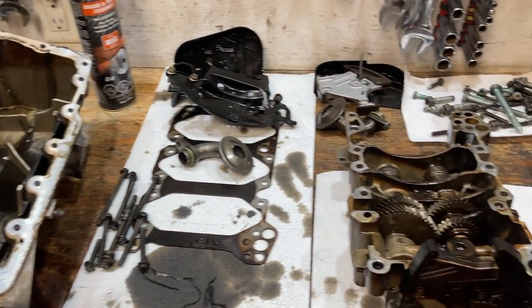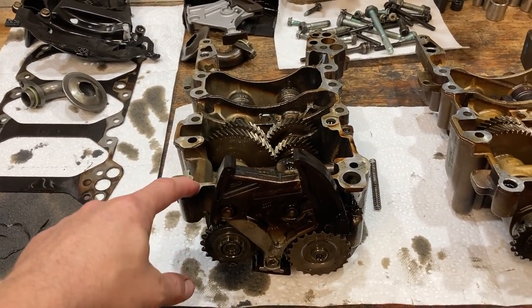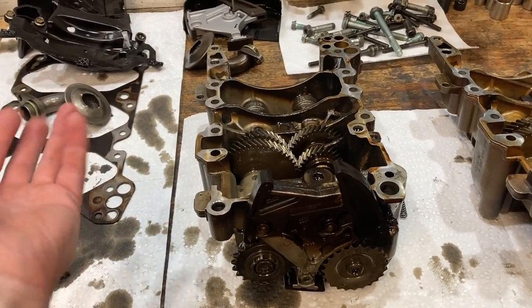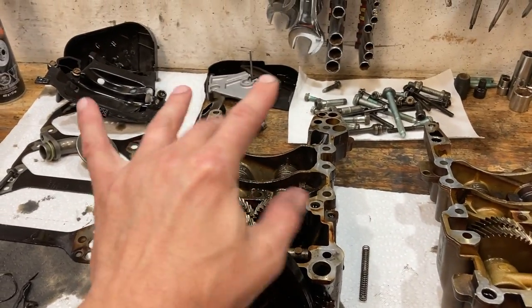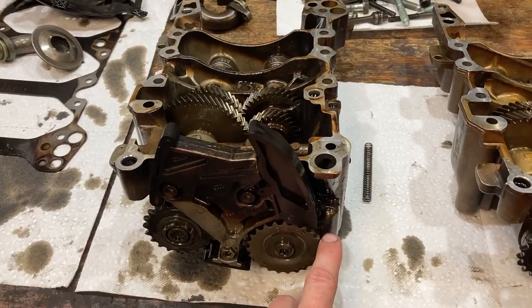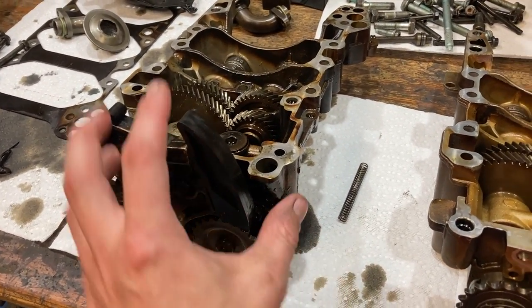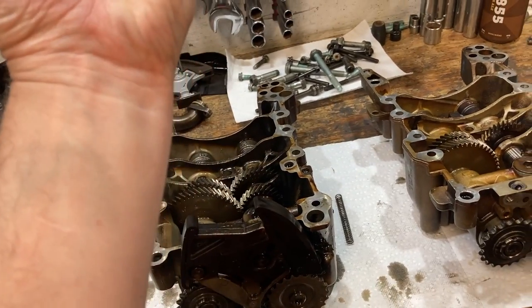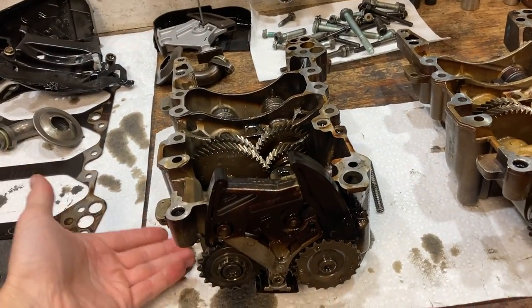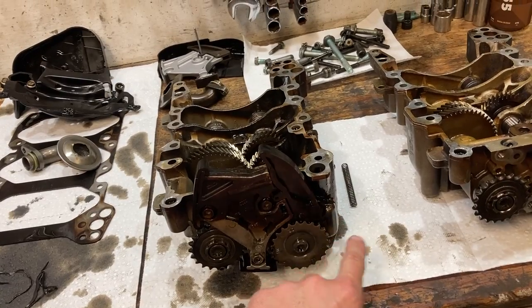Here's some of the carnage that comes with removing one of these oil pump balance shaft assemblies. This is my 2007 Audi A4 BWT engine 2L oil pump and balance shaft assembly. You have your crank up here spinning some pistons, and on the end of that crank you have a sprocket with a chain that comes around this tensioner, comes around this oil pump here on this sprocket. Your oil pump feeds this whole assembly through a pile of galleries and feeds the shafts back there and out to the rest of the engine, back down to the oil pan, picked up by a suction pickup tube, and continues that cycle.